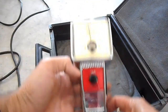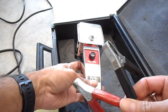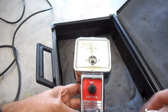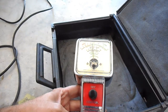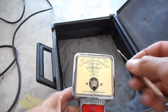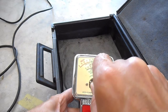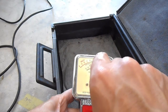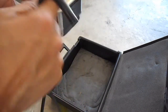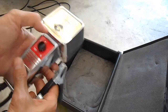On the actual unit there are two leads. One lead goes to some alligator terminals which connect up to a power supply, and the other lead goes to the sensor. Now on the unit you need to initialize it. At the moment it's not connected, and the needle is a little bit before the set mark. You just need to use a screwdriver and adjust this needle so it is in the set position. The next step is to connect it up to the power supply, and then you still need to adjust this set control knob to get the needle back to the set position.